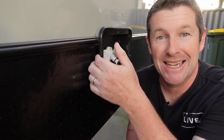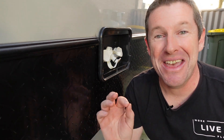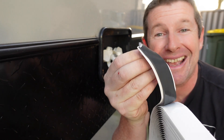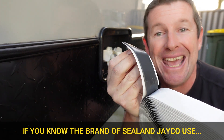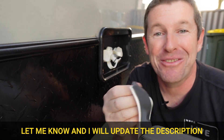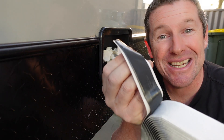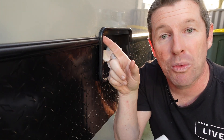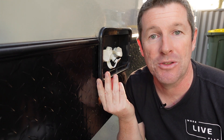The problem with silicon is it's extremely hard to clean off, particularly on checker plate materials. In most cases, and with newer Jaycos, there'll be a butyl sealant used to seal and mould these onto the side of the van, whereas older models are sealed with silicon. So my hunt went on to finding some butyl tape, and it actually wasn't that hard — I found this particular tape from Amazon and it came the next day. I'll put a link in the description.